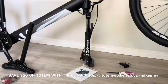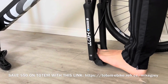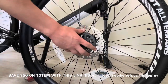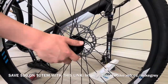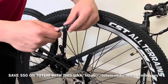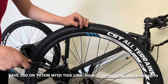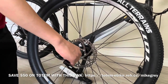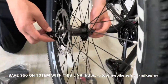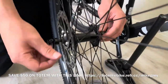Once that is in place, your next step is to remove that plastic piece that is just there as protection for the fork. Next, grab the wheel and remove those couple of black plastic covers. Grab the quick release out of the small brown box. Spin off the nut and take the spring off. Work the quick release through, notice the direction of the wheel and the metal brake disc, then put the spring back on and spin the nut back into place.